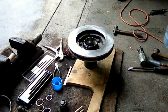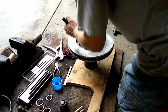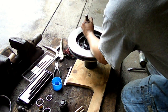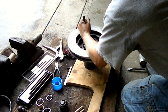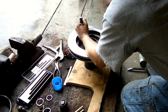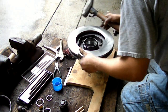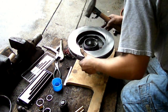And then came time to put the hub and the rotor back together. Due to camera operator error, I didn't actually record the first part of this, but it's fairly simple. Basically, you just put the hub back into the rotor. It doesn't have to be the same rotor, just as long as it's one of them. Then what I did, you don't necessarily have to, is take anti-seize and put it against the two faces that touch on the hub and the rotor, basically the seam there.